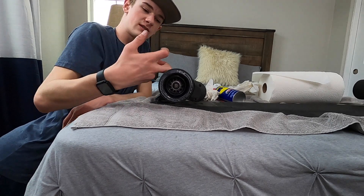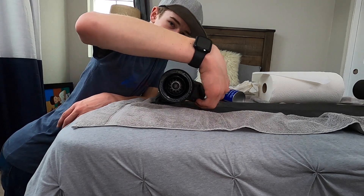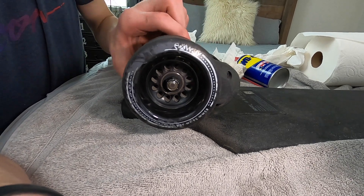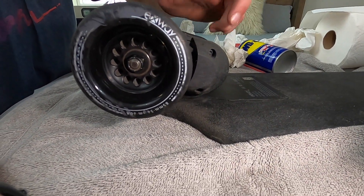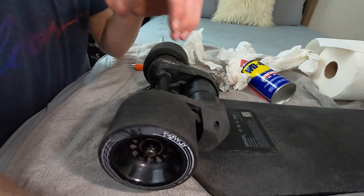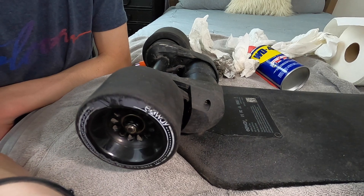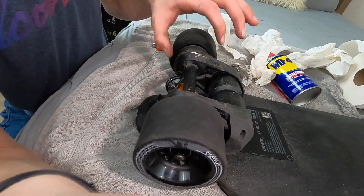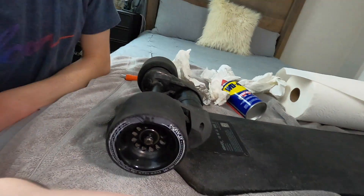You could go deeper into this. All you need to do is grab Allen wrenches — there are bolts all along this that basically take off this shield right here, and there are three also behind this motor mount. All you have to do is unscrew those and you can take this whole casing off, which basically protects the motor and anything else inside. You can take this entire thing off and just leave the axle, just like in the front.